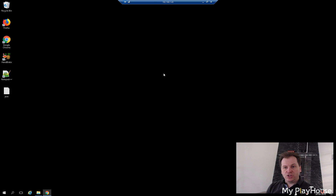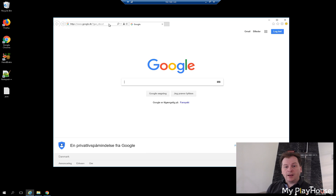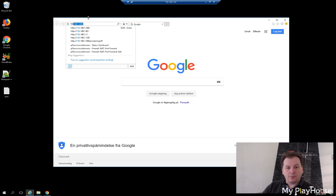I've moved to the computer and we're gonna go right away to a remote — I call it a jump server — and we're gonna be trying to set up access to an RSA 2 adapter. The same thing should apply to the later versions of the IMM adapters. I'm on a virtual machine doing remote desktop, and what I found is that Internet Explorer is the best browser to use when messing with management on IBM/Lenovo servers, at least the older models.